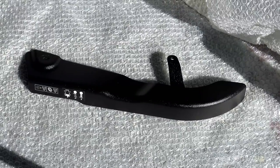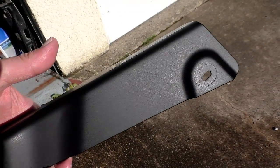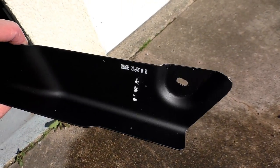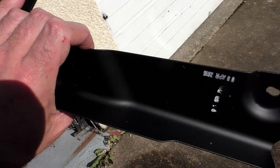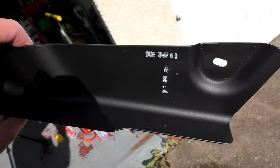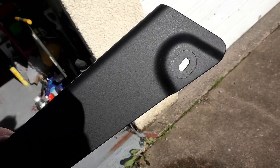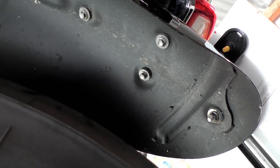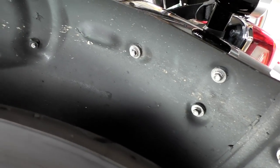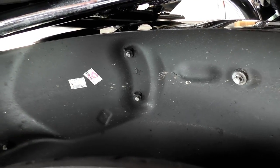Once applied, in warm temperatures it will take one to two hours to dry; in winter it will take substantially longer — probably needs to be left overnight. It dries to a clear, non-sticky matte finish. You should inspect it at least once a year, but in practical terms I'd say it would last between three and five years before you need to think about re-coating. When I first got the Bonneville I identified the rear mudguard as a problem area — there's very little impact protection inside the wheel arch and the mudguard is made from steel.